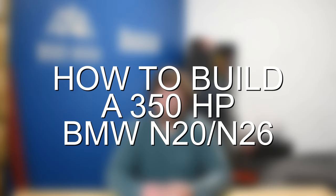Let's jump into the bulk of this video and discuss the five best BMW N20 upgrades to push the engine to 350 plus crank horsepower. Number one on the list, jumping right into the best upgrade for the BMW N20, we have tuning. A tune is really the key to unlocking the full potential of the BMW N20. Just a tune alone can provide gains of roughly 30 to 50 wheel horsepower and 40 to 60 wheel torque. For a $500 tune, those are incredible power gains, and this is going to be the best bang for your buck modification on the BMW N20.